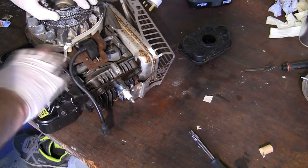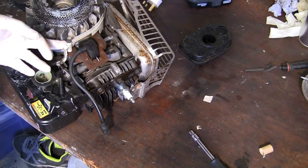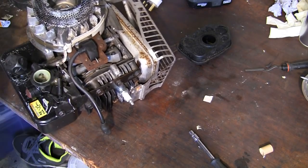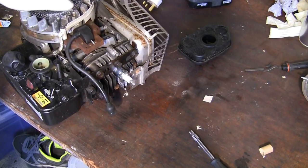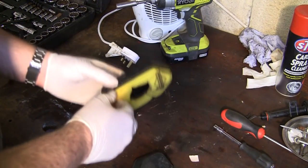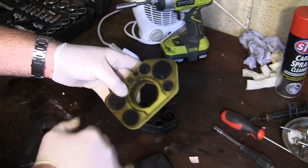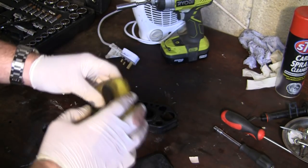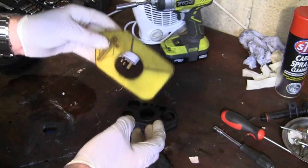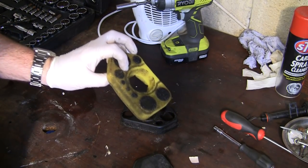Petrol tank is nice and clean, springs and linkages all moving correctly, no mess inside anymore, ignition coil gap set. Now we need to look at the air filter - I don't generally replace these. You can see if you get some old fuel and dip it in and squeeze it out a bit, you can actually get these pretty clean again. Then put a really fine coat of oil back on when you put them back through, squeeze it all together and it just stops all the dust blowing through. If you see one of these that's completely black, it's because someone's tipped the mower completely over and it's full of oil. Give it a good clean off - that's all you need to do. Pop that back in and that whole thing is done.